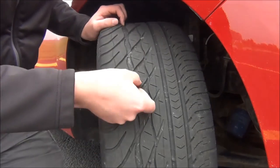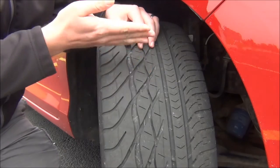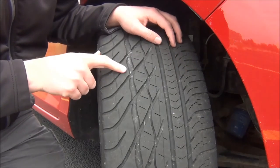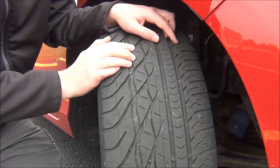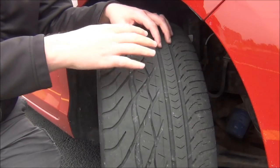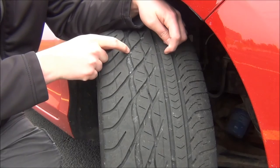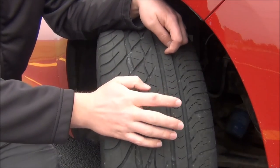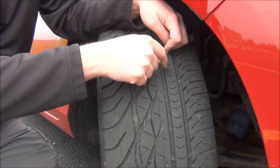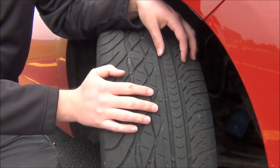As we move further in, we have these little slits here. You see most of them on this part here, but there are also a few here. These little slits are usually angled, and they are called sipes. We have some wavy ones here that are harder to see because this tire has some wear on it — if it had more tread, the wavy ones would be more visible. These little slits called sipes grab onto the road. As the tire moves, the tread bends a little bit, and these grooves provide a biting edge on the road to help pull the car along. They are great in icy and snowy conditions as well as wet conditions. You see a lot of sipes on winter tires because they need a lot of biting, gripping power to get through snow, but they are quite often seen on all-season tires as well, just not as many.